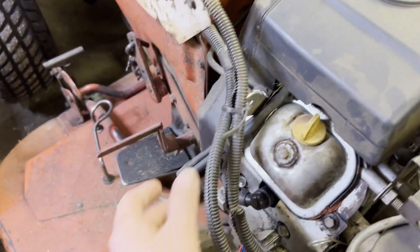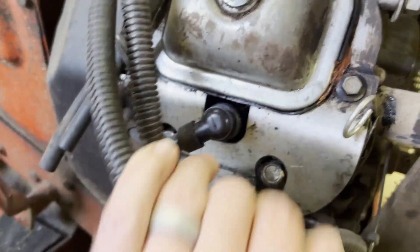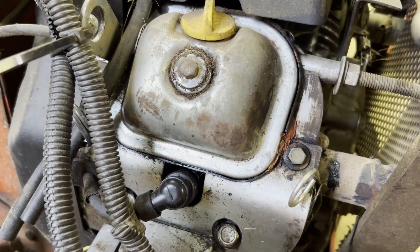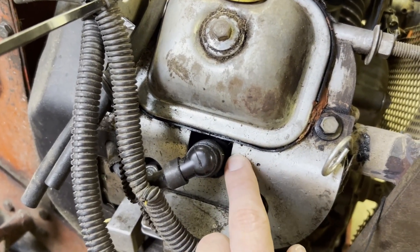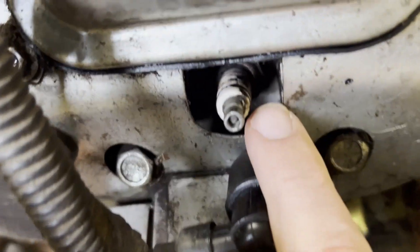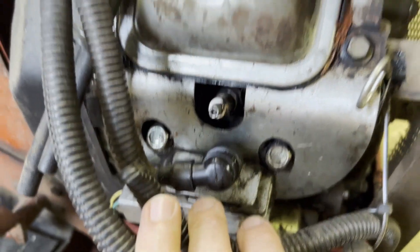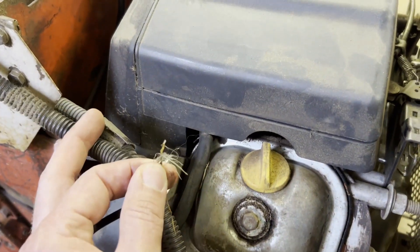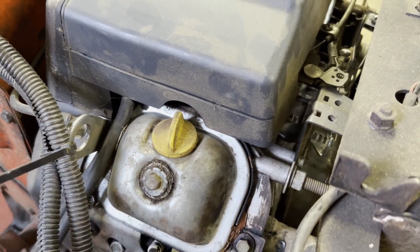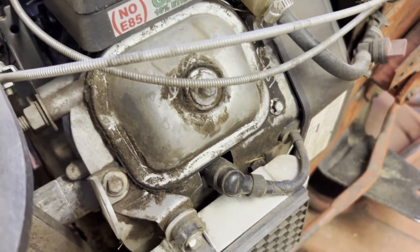With the hood off — this is an engine transplant, a repower of an old Simplicity lawnmower, and the engine fit in pretty well. On this side valve cover gasket there's a big gap and I had pulled it off and used some high-temp silicone to try to seal it up. It worked for a little while, but it continued to leak. There was grass and dry leaves packed in here, and you can even see oil still on the spark plug, dripping onto the plug boot. This had actually combusted, but no big deal. Should be a simple enough job — just get some hoses out of the way, pop it off, and replace the gasket on both sides.